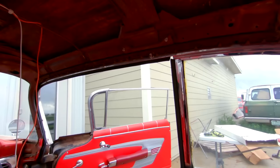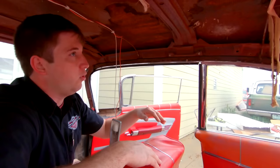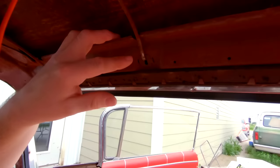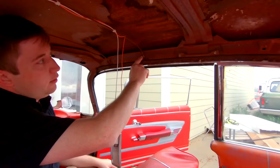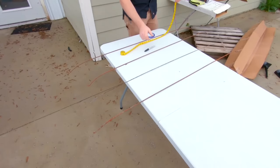We go through and pull out all the little staples. Do you have to do that or does it just give a cleaner look? It gives it a little bit cleaner look — your trim is gonna hide all that. So it's just kind of how detailed do you want to get with it. These are still pretty supple, they're not hard like a brick, so they're coming out pretty easy. One thing to know before you take these bows out: mark which hole they are in. Not necessarily just on a 59 — if you're doing any bow headliner it'll have three holes.